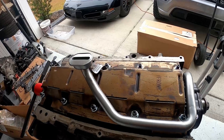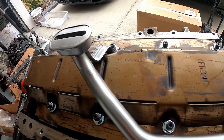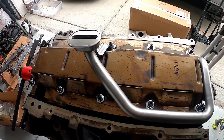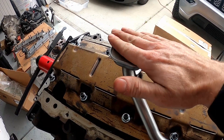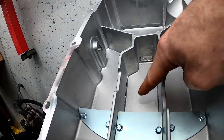To spare you the details, I removed the oil pickup tube and put the oil pan back on, and it sat down perfectly — so it's not the windage tray. It is this pickup tube here. It is hitting — well, resting on that guy there.